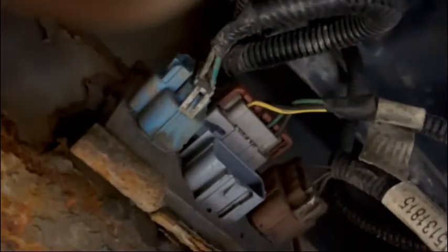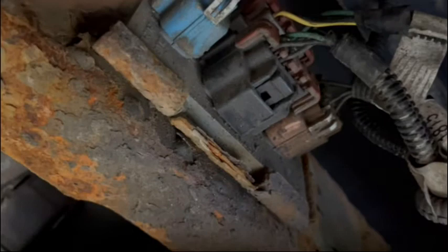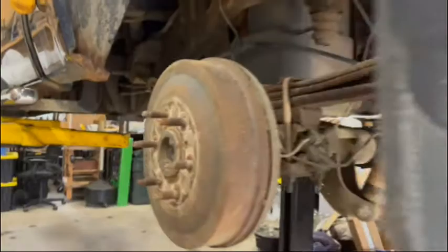This is all the stuff I had to do when I took the body off. There's a plug block right here — I labeled this one 'top' — I had to unplug these two wiring harnesses that went up to the body. The other two I didn't have to worry about: one goes down to the trailer hitch and the other stays on the frame. So those two just unplug. Now my lights will work again. As soon as I get the gas cap back in, the truck should be ready to go — oh yeah, put the tires back on too.